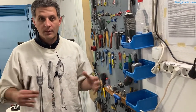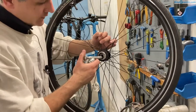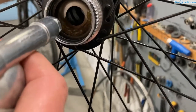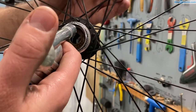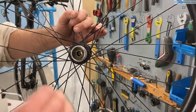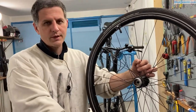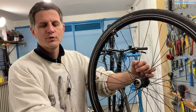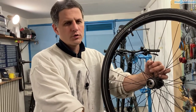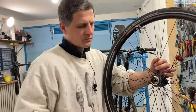Now we will show how to pack it all up and put it together. The first thing I do is put some grease on the area where the bearing balls will be placed. I'm using a semi-hard NLGI2 hardness grease, which is not too soft and holds the bearing balls nicely in place. For bicycle bearings, softer greases are quite okay — perhaps even better technically — but they make maintenance more difficult because the balls won't stay in place easily. I've had no problems using NLGI2 hardness grease and it's worked fine for me for decades.